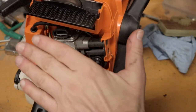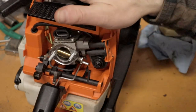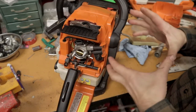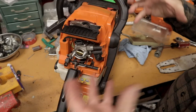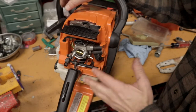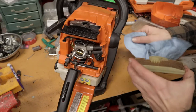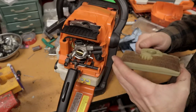I do need to run a tach on it to make sure I'm not over-speeding it. I honestly think that these saws are pretty darn good. I know they have a non-professional cylinder or case setup where you can take the cylinder head off. I think these are actually detuned just to make it so they don't compete with their pro saws. I could be wrong on that, but it just seems like when you do that mod, it's not that it ran super high performance — it just ran right.